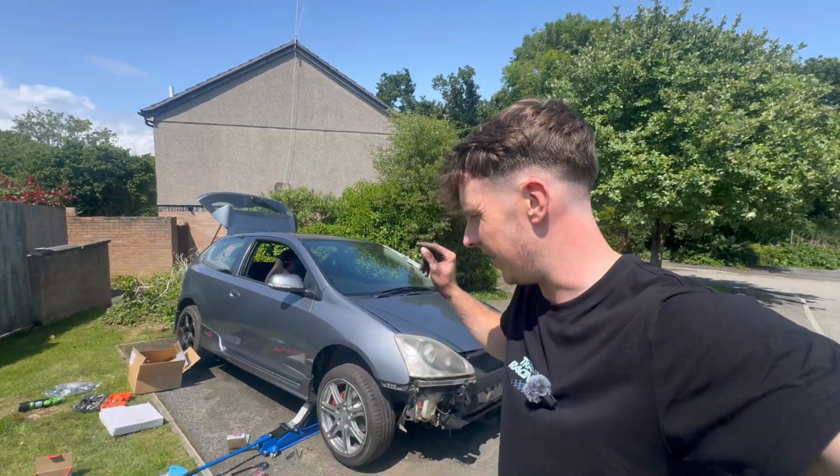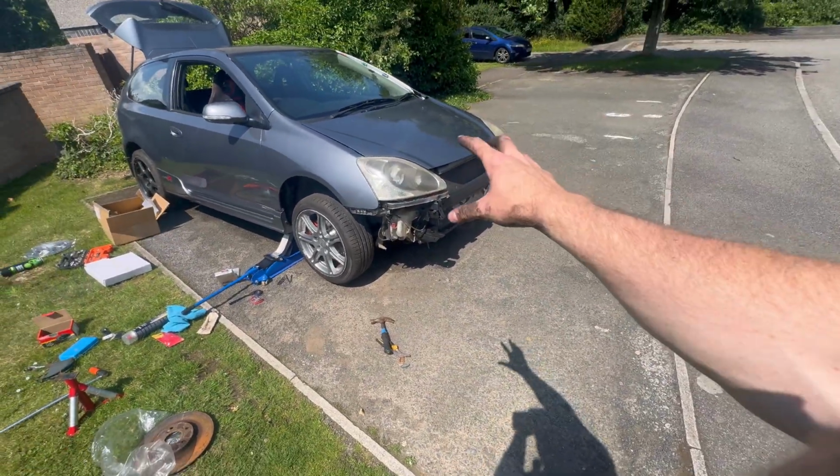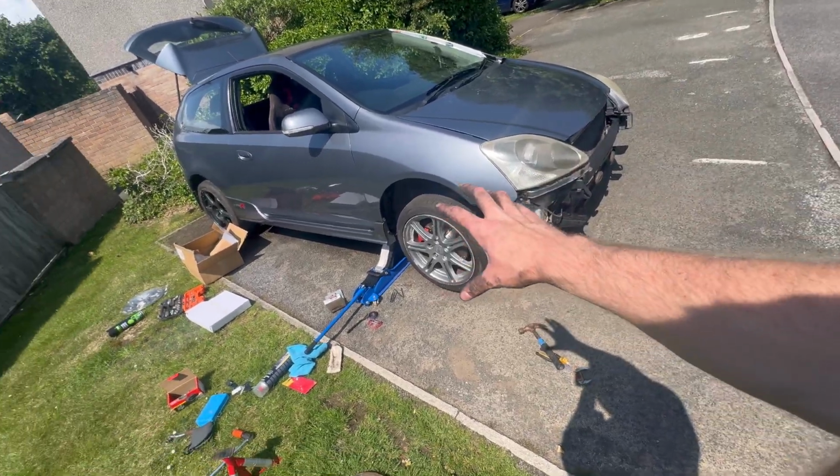We have the new discs on the car. What an absolute pain that was. I'm going to get the car onto the ground now. And then because I've changed the TPS and the knock sensor, I'm going to take it out for a drive, see if it drives any better because it was driving pretty lumpy before. And if not, then we'll need to go other ways of finding out what is actually wrong with this car. But I'll get the car on the floor. We'll get it rebuilt up a little bit, tidy all this up, and then go out for a little drive.